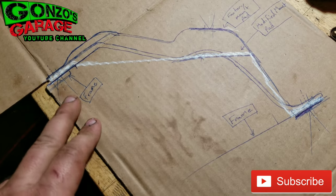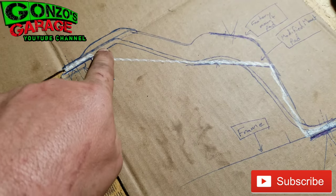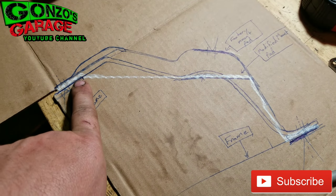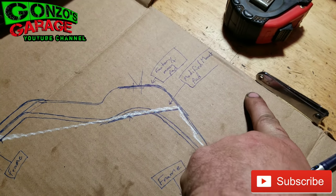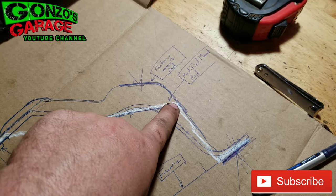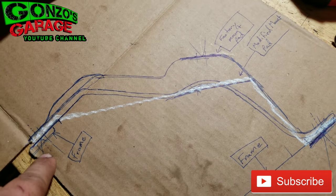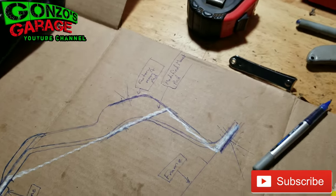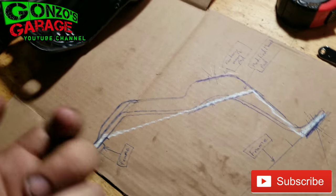So what we have here is the inner frame rail, the top of the frame rail, the top of this pedestal, and the cross member. This comes across the top of the frame rail at an angle straight towards the oil pan — the top of the Moroso oil pan is right around in here somewhere. I just took a straight shot there and found this angle to mimic that lower mounting point. Once I got it on cardboard, I put it in the truck, made the holes, got some push pins, held it in place, and it all lines up perfect.